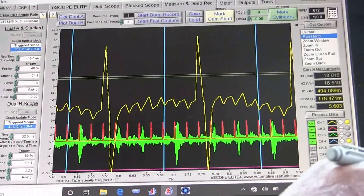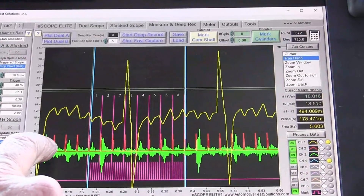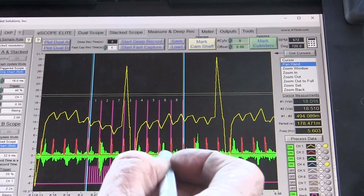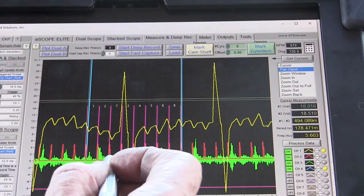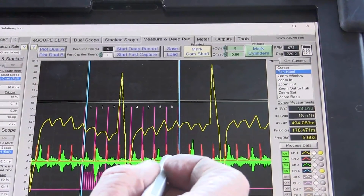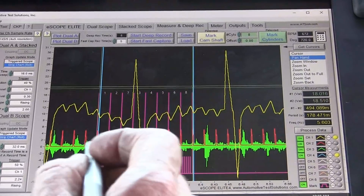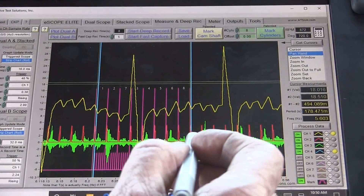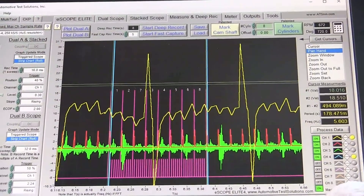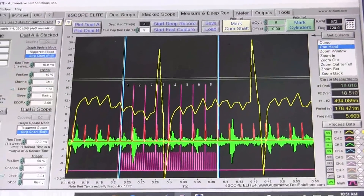Next I want to turn on my knock signal — now this is the knock signal that's being generated. So we can come back over and take a look at these. Two has a little bit bigger knock. Four has a little bit bigger knock. Six has a little bit bigger knock. And I can see the knock on one and seven and three, five, six. Some of them are even bank, some of them are odd bank. The one that really looks like I've got something going on maybe right now is two — this is a lot bigger. But I don't really feel a problem right now and I do not hear a knock. The engine sounds pretty normal. These engines have a knock because there's no pilot injection on these engines.